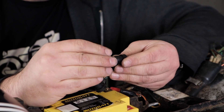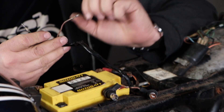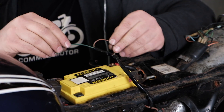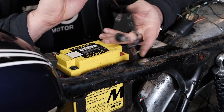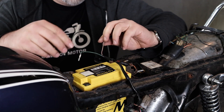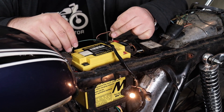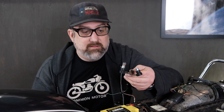Let's go ahead and test the sockets to make sure they're working properly. I'm going to put the new bulb in there, then touch our green wire to ground and our brown and white to 12-volt positive on the battery. That kicks on — socket's good. Switching the bulb to the other socket and running the same drill — there it is. Sockets are good too. So the sockets and wires are good for that gauge; we just need to change the bulbs and the gauge will light back up.